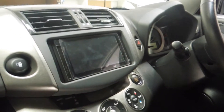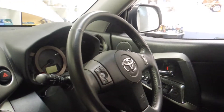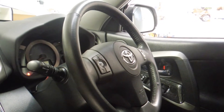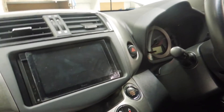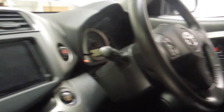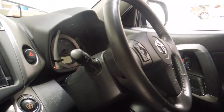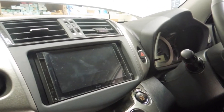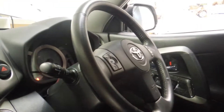Up here it's all back together and finished. It took a bit of playing around with resistors but I finally got all the steering wheel controls going. The problem was that the four basic buttons — volume and seeking — were on one channel, and then the source, phone controls, and voice control button were all on the other channel but at the exact same impedance, so the stereo could not detect the difference between them. What I had to do was put a 1k2 resistor in-line with channel two, then parallel that onto channel one, and after that everything started working.